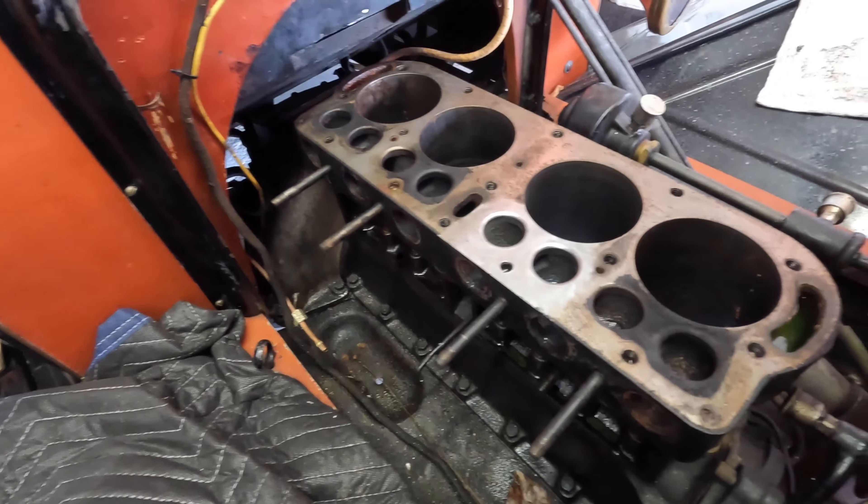Let's see how the valves look. Looks like we've got the right size and we have a good fit. This is piston and rod number one - you can see a number one right there. That number one goes towards the right side of the engine when they get installed, and that's the same way the dipper faces too. These particular pistons are aftermarket aluminum pistons, and you can see they have a slot on this side but not on that side, so these pistons are actually directional. The slot faces to the left side of the engine when you put them in.